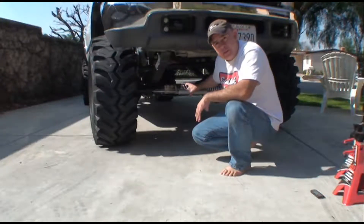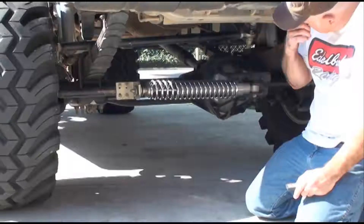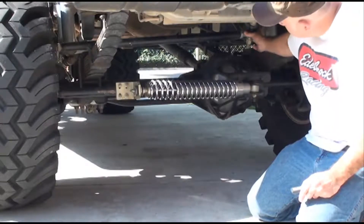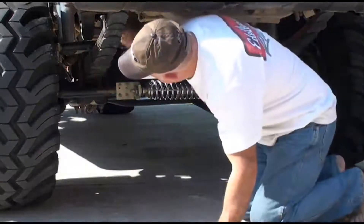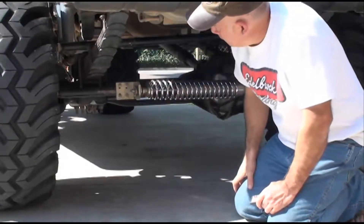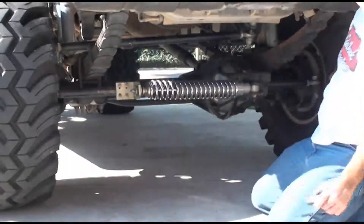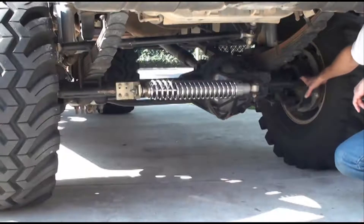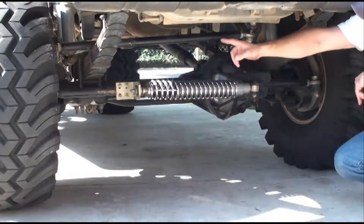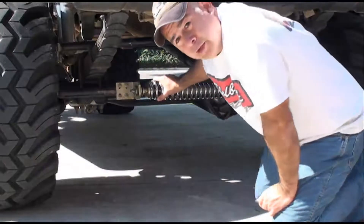Slow it down, smooth it out. Take some of the load off your steering links, your steering box, all the way up to your steering wheel. You've got your steering box up here, the Pitman arm coming off it, with a link that goes across — over to your steering knuckle — called the drag link because it's dragging everything back and forth. The bottom one is the tie rod, tying your right-hand side tire over to your left-hand side tire. Anytime you hit a bump with the right tire, it transmits that energy through your steering links, to your steering box, to your steering wheel. The damper is supposed to soak a lot of that up.